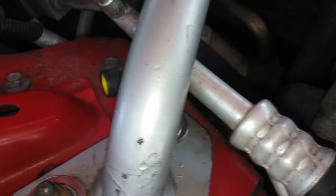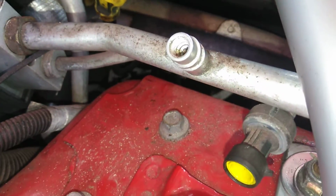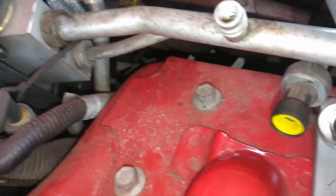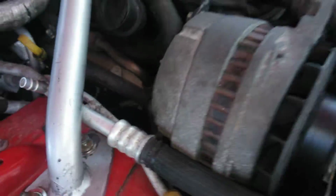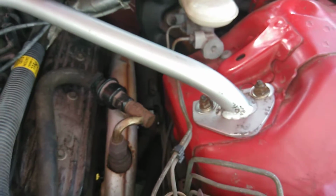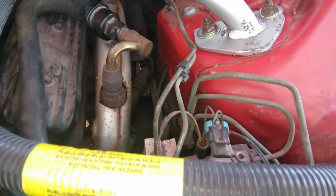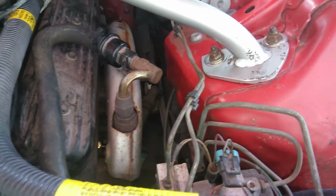These insides were a nice little treat to get to. You gotta get them from here to here. They say take this sensor off, but I ain't messing with it. I ain't fooling with it. I got the wrench right in this angle here and pushed it right up under the sensor. Now, this is the best part. After I got the 2 outside bolts, I worked on the 2 inside bolts with a 15mm wrench. That's what you're gonna need.